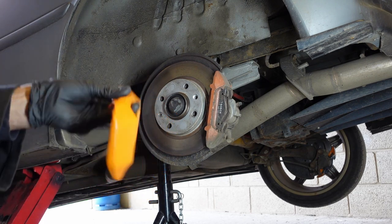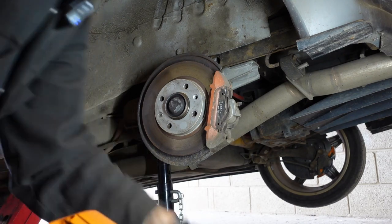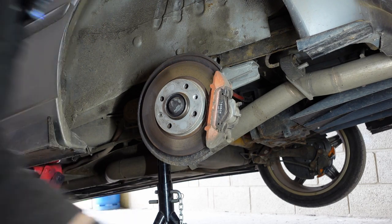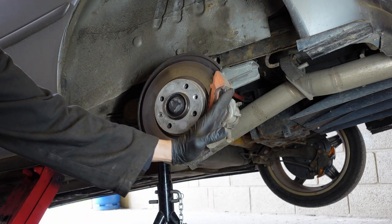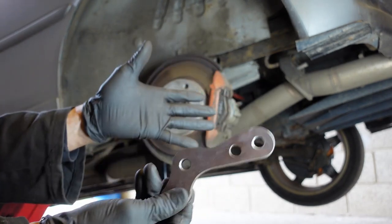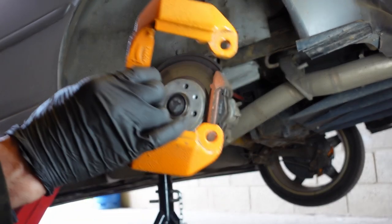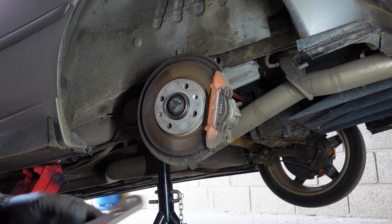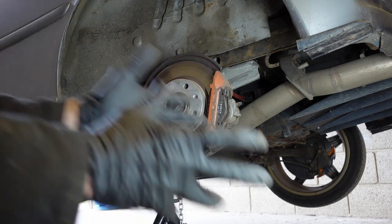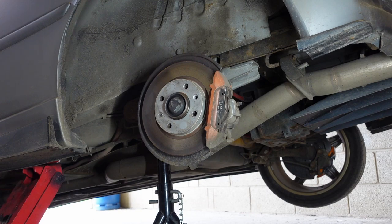One key is this, which is a wider pad carrier. This is a narrow pad carrier, and the narrow carrier doesn't allow for the bigger disc and the bigger pads. Now the other problem is that the pad carrier and the caliper need to sit out slightly further, so here's the other little key to it. If you're interested, I am making kits that will just bolt on — basically. You'll get a pad carrier, a couple of bolts, a couple of these, a couple of discs, and a set of pads, all as one kit that you'll just unbolt and bolt back on. Winning.